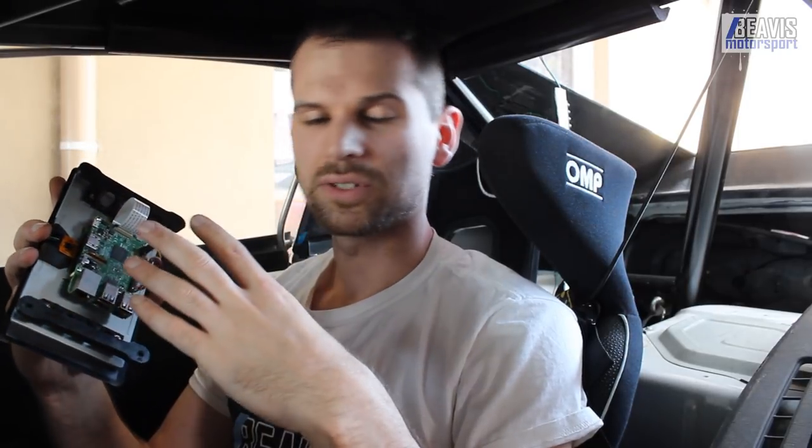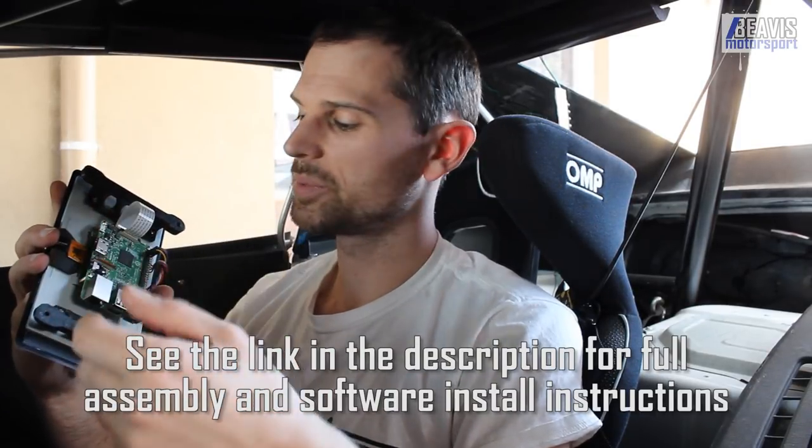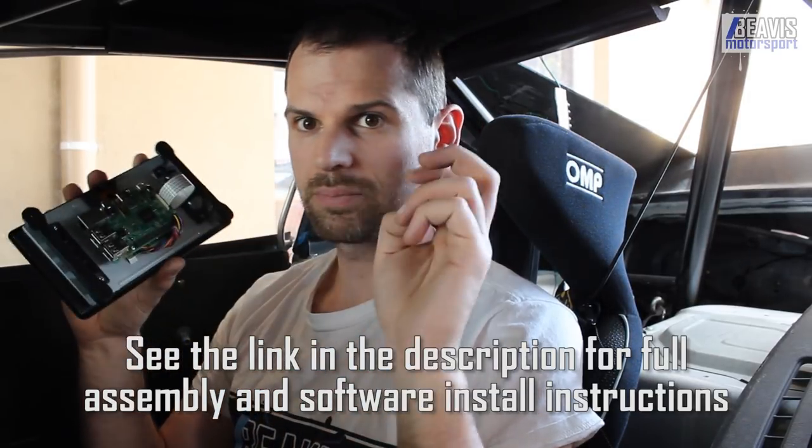You've got to be familiar with Unix or Linux, although if you can use Windows you can probably just work this out. Follow the instructions and it's fairly straightforward. Effectively, load up an SD card with the OS that you download from their website, plug that in, boot up the Raspberry Pi, it'll install the OS and then load to a desktop — from there you go and download and install Tuner Studio. The cool thing is you're not having to use Android software like I had to use on the tablet. On this, you can use a Linux version of Tuner Studio, so you've got the full Tuner Studio, which is really cool.